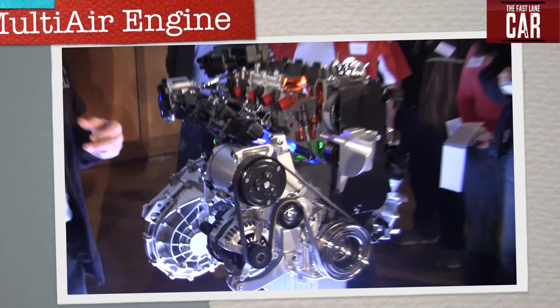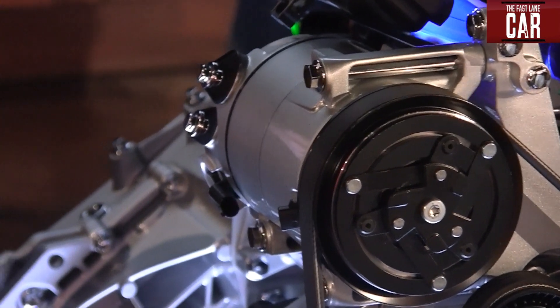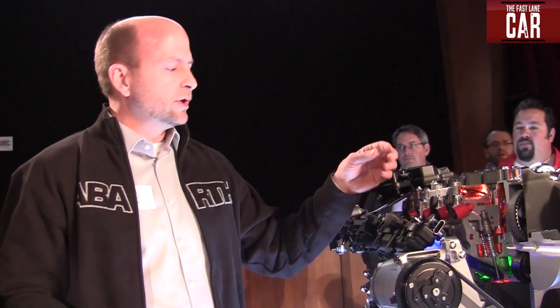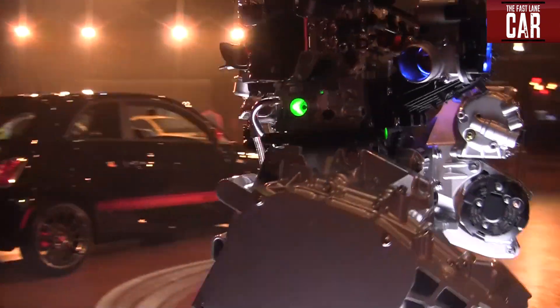The MultiAir really gives us complete control of the intake valves, and controlling intake airflow is really the holy grail of internal combustion engine operation. With MultiAir technology, it essentially takes a dual overhead cam engine, throws away the intake camshaft, and replaces it with what we call the MultiAir brick — a combination of four sets of MultiAir actuators operating via a very high pressure hydraulic system oil actuated by a single lobe on the camshaft.